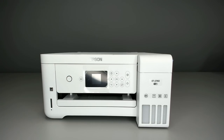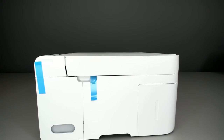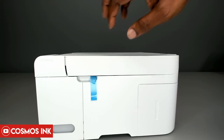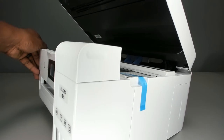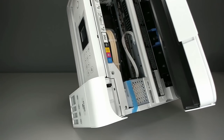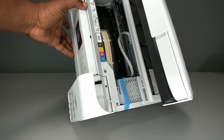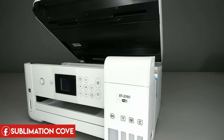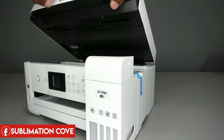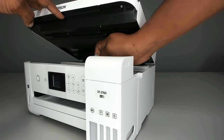Most of the tape you can see on the outside, but others you may have to open the printer up to access. There's one on the side here that's wrapped around going inside. You really have to open up the top of the printer — you'll see how that piece of tape is wrapped around the printer head. That's just to keep it in place during shipping so it doesn't get damaged. Get this piece from the corner, pull it up, and it'll come right out.